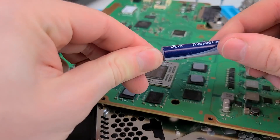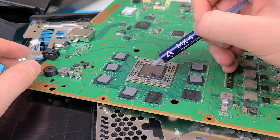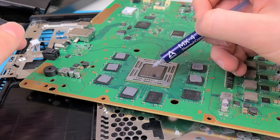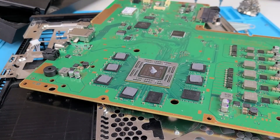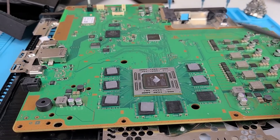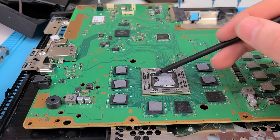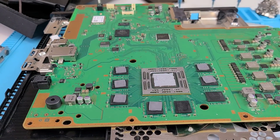So we're done cleaning. Now we can get our thermal paste and we can put just a little pea-sized blob. You guys are going to make fun of me no matter how much I put, so just chill. If you guys get mad at that amount — I have to spread it around and I don't have the thingy that it came with, so I'm just going to use a spudger. That looks good to me.